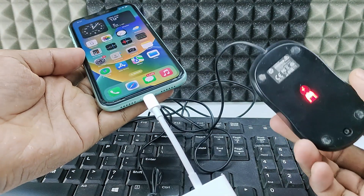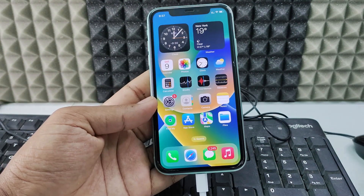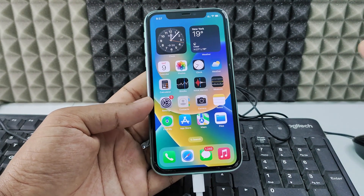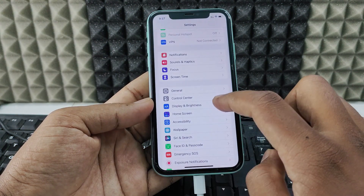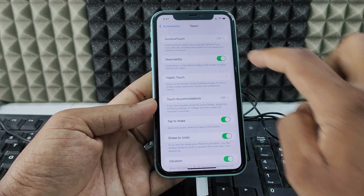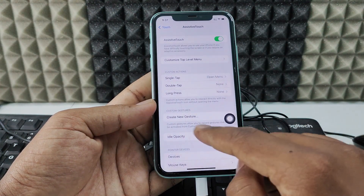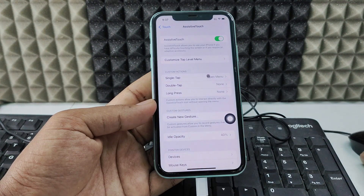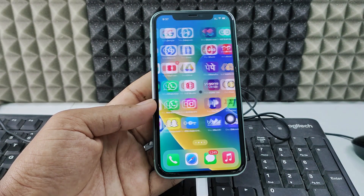You can see the light indication on the adapter. Now it won't work immediately — you need to open Settings, scroll down and open Accessibility, then go to Touch and enable Assistive Touch. Once you turn that on, you can see the pointer appearing and moving on screen.